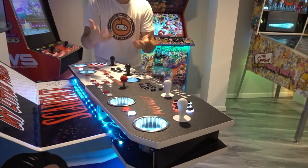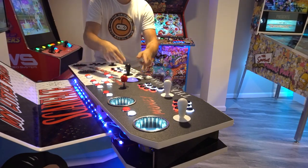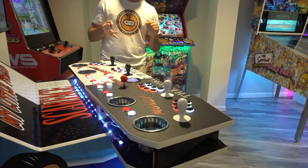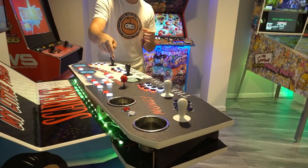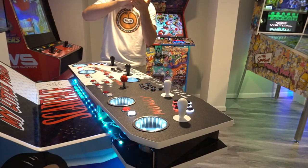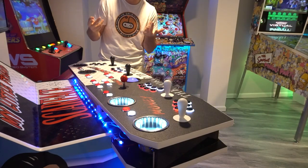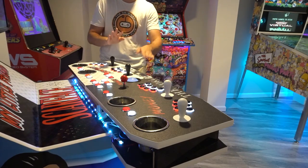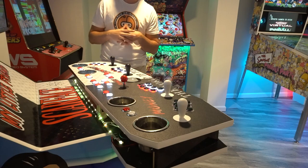The last thing is kind of the downside to the trackball. I have the trackball with my LED strip going to the color, but adding 40 bucks for a pre-LED that goes with the mounting plate — I think that's ridiculous; it should have been included. Also, I had to do extra wiring — I actually had to cut the plastic casing to get the mouse inputs working. It comes with a black connector with three prongs, but out of three prongs only two had wires, and the one needed for left click didn't have a wire. So if you're looking at the U-Track: great trackball for USB plug-and-play for the mouse wheel, but be prepared to do extra wiring for mouse left and right inputs.